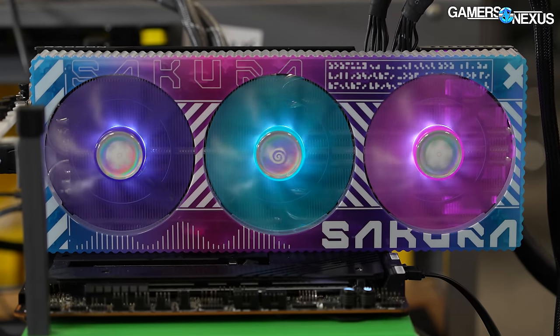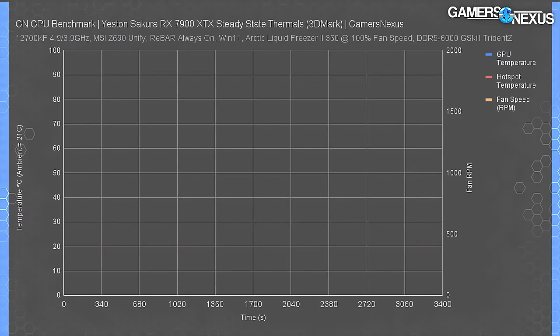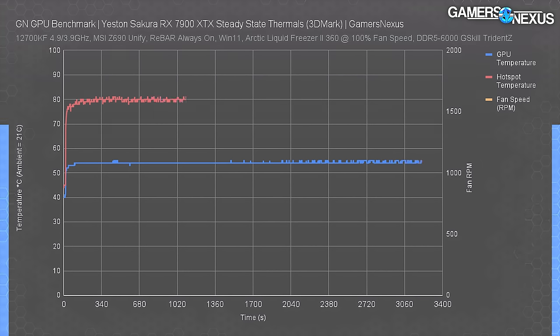The first test is conducted prior to ever disassembling the card - zero interference, straight out of the box, no thermocouples. The first chart plots temperature with the default V-BIOS and its default fan curve. The GPU ramps quickly to a steady state of 54°C. The core temperature is actually great, but we need to factor in noise to know how it is in total. There is one immediate downside though: the hot spot climbs to about 80°C, posting a massive delta of 30°C against the core average. Thirty degrees is enough that in a hotter environment the GPU will clip frequency and potentially drop clocks just from the hot spot temperature alone.